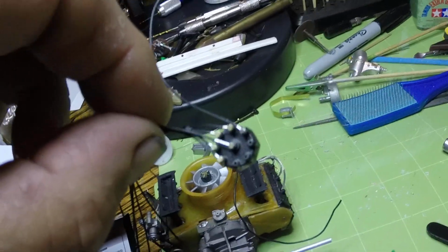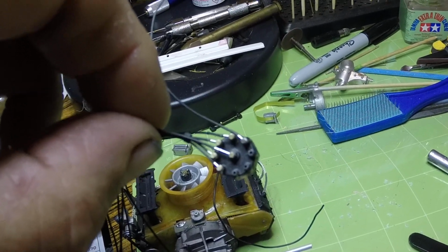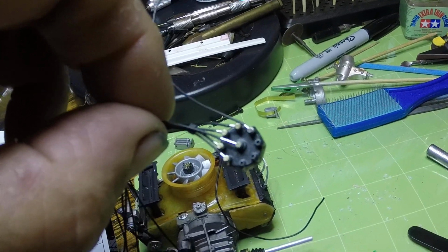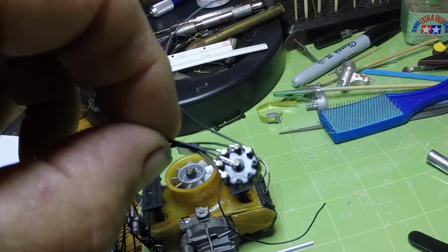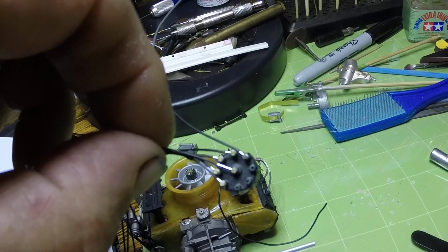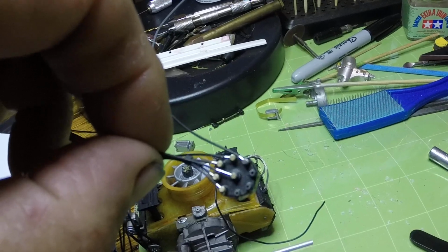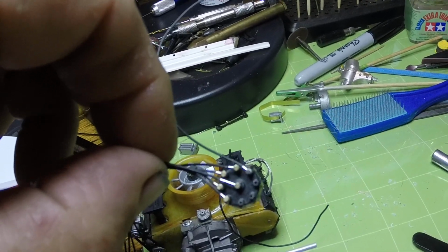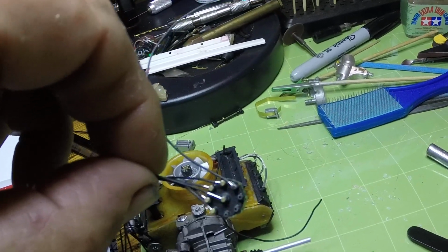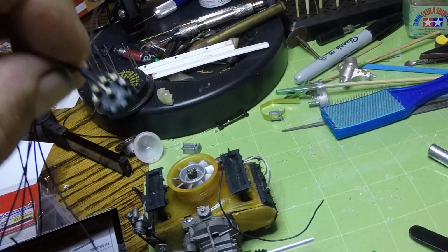And on this car, you'll notice that there's 8 ports for the fuel fittings, but this is only a 6-cylinder car, and my guess is they probably used a fuel distributor off of a Mercedes V8 engine or something, or maybe even a 928, which would have had an 8-port fuel distributor. And they basically just put bolts to cap off the 2 that they didn't use. Anyway, in the kit, I ran out of parts, so I have to order another kit to finish that job.